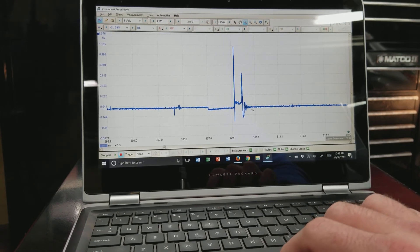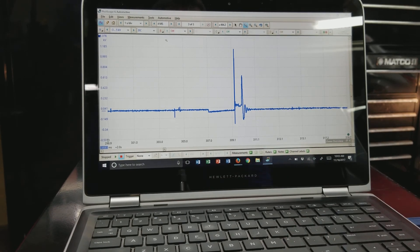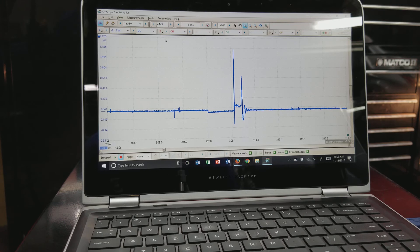That's the difference between a fuel misfire and an ignition misfire. This is a nice quick way to determine if your injector isn't flowing fuel the way it should be. We're seeing a lot more of this because people are keeping their vehicles longer — you've got 250,000-mile Toyota Camrys going around town starting to see some fuel injector clog issues. Hope you enjoyed it.